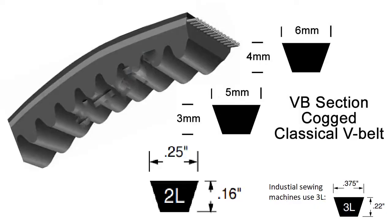This picture shows the V-belts found on the marketplace, and there are four types for sewing machines. The drawing shows the cross-section with dimensions: one is 5mm wide, then 6mm wide, and finally 0.25 inch, which is about 6.3mm — this belt is called 2L. Normally the 6mm and 6.3mm are almost the same and can use the same pulleys, but the 5mm belts often need other pulleys.